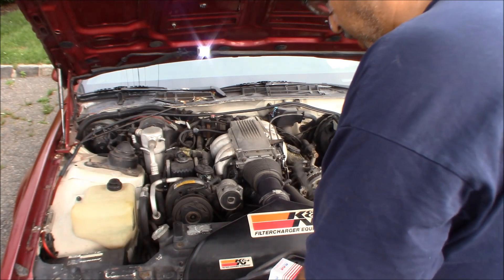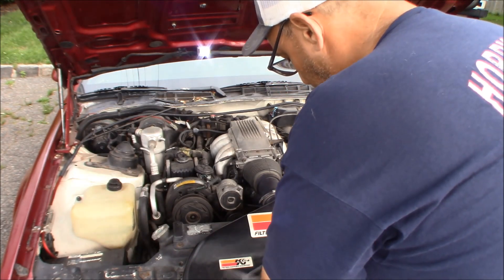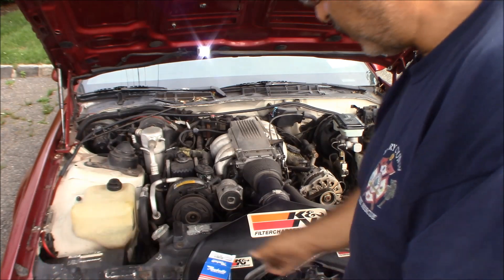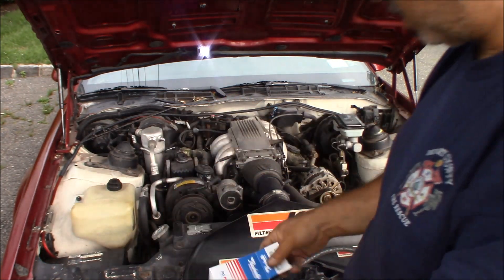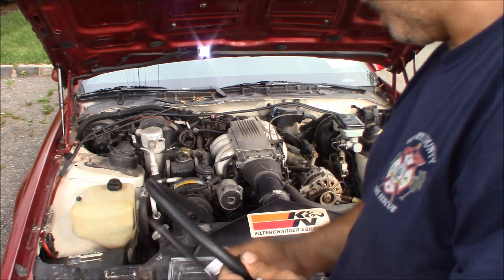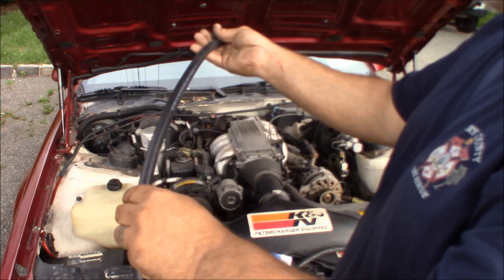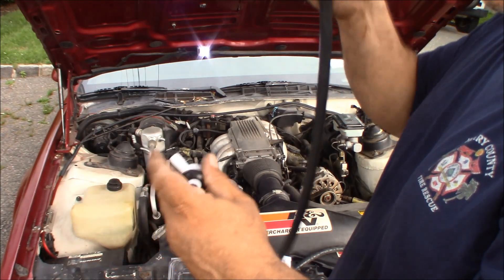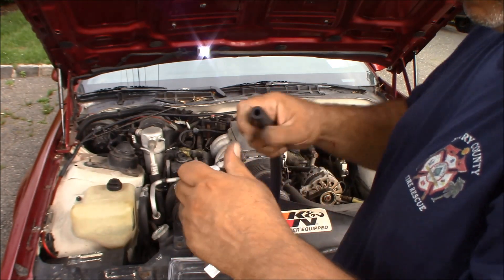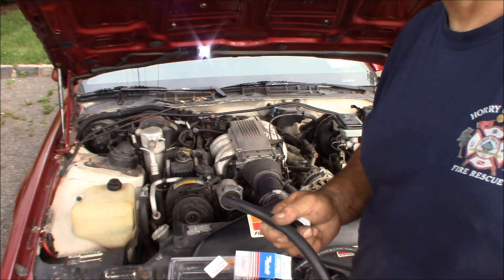I'm not sure if the old one is proper brake booster hose or not, but what I do have is a new check valve — I'll link it in the description below. I also have some Gates power brake vacuum hose, which is what this specific hose is called. It's made in Mexico, 11/32 inches, and it fits nice and snug on the brake booster end.